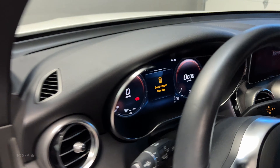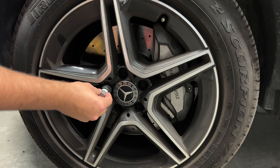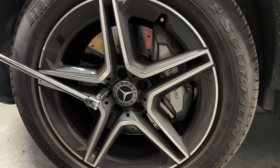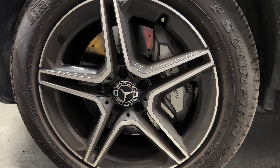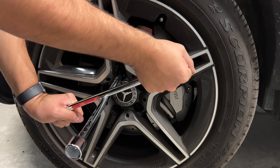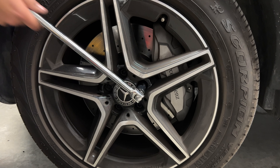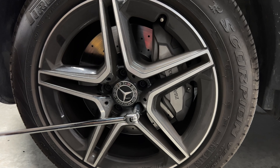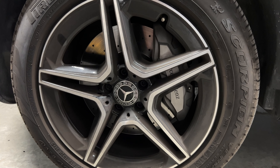You can see the parking brake is on. I like to start off with the lug bolt that has the key and break it loose — really easy if you have a breaker bar, but if you don't, you can use a three-way lug wrench; it just takes a lot of force. Make sure you do this so it'll be a lot easier to take the lug bolts out when the vehicle is lifted. I'm going to do it to the rear wheels too.